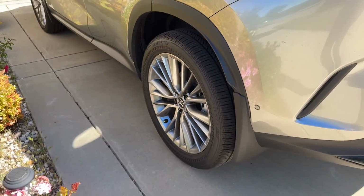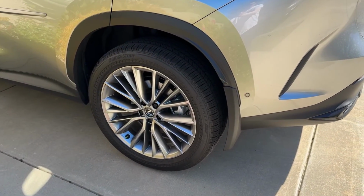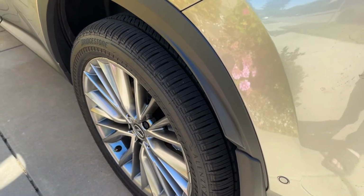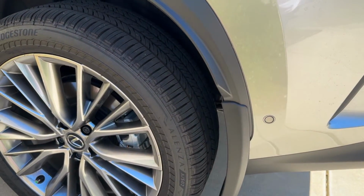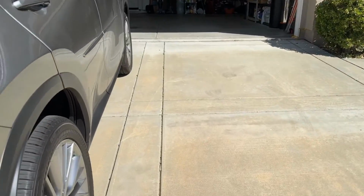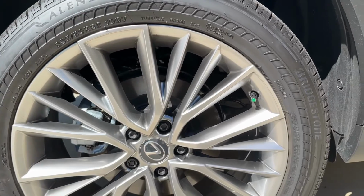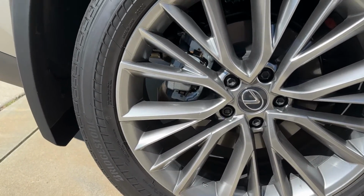And of course, that depends on the brand of run flat tires. So, like Pirelli, for example, you cannot repair it. They don't recommend repairing it. That's their policy, all right? And sometimes when you repair a run flat tire, the warranty or the speed rating and all those may change. And if you have an all-wheel drive, like in my case, if you were to change one tire, you have to change all four actually. So that's the gotcha with run flat tires.